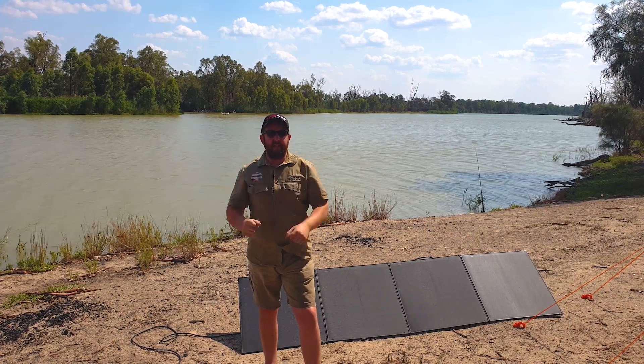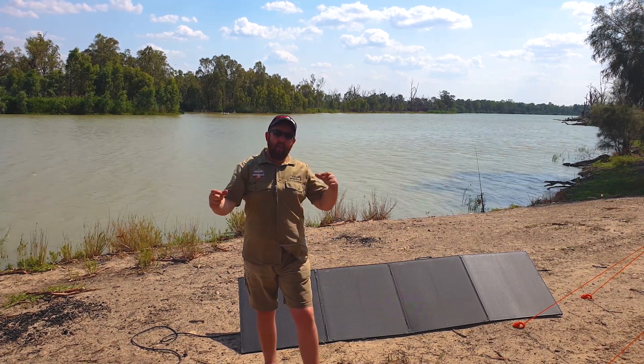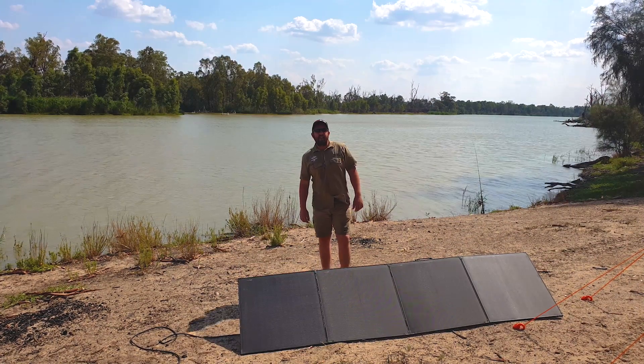So to maintain your 12 volts and double your amps, make sure you run your positive to your positive and your negative to your negative. Then all your accessories you run off one of the negatives and one of the positives — so it's just combined into one battery. It's that simple guys.